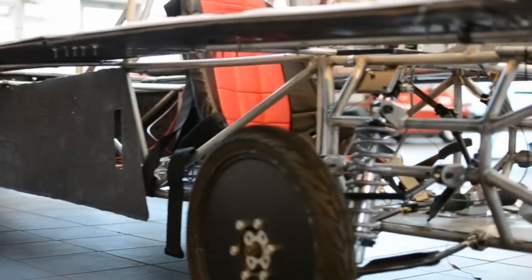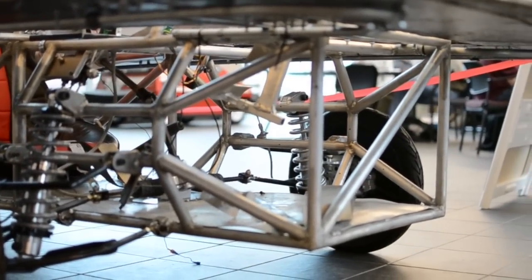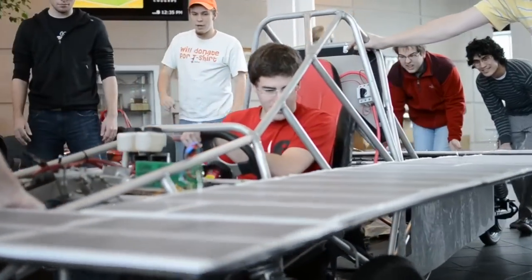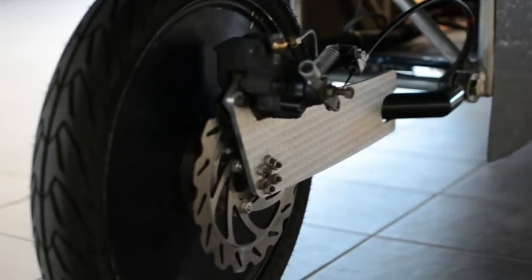A solar car differs from a regular car in the fact that it really has no protection around it. It doesn't have bumpers, it doesn't really have crumple zones. The frame itself weighs 90 pounds, and the car fully loaded with driver weighs 610. We are pretty much limited by our motor to about 45 miles per hour, but if we get a new motor, we should be able to hit 65 or 70. The current Black Nova is almost complete.